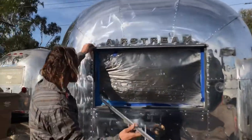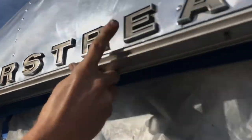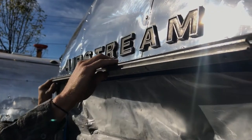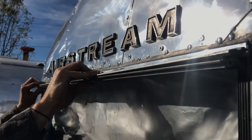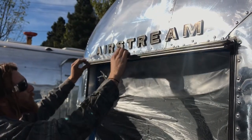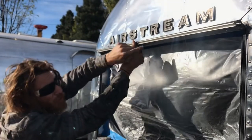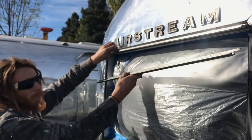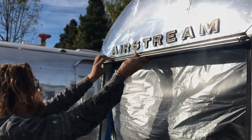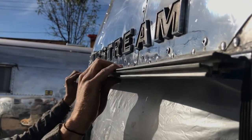When the window got smashed, I had a bunch of broken pieces and this piece was on here just like that. I was wondering how to get it off. There's a little latch connected here — I took the latch off, and I gave a call to my friend Jason Dorchester at Dorch Design. He told me this piece actually just comes right off. It was completely caulked on. We're going to re-caulk it when we seal it back. I had to remove the caulking, remove the glass, remove the screws, and then this piece just popped right off.